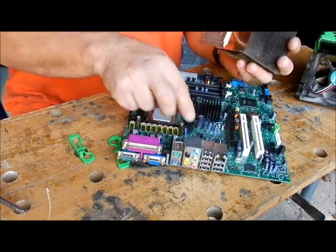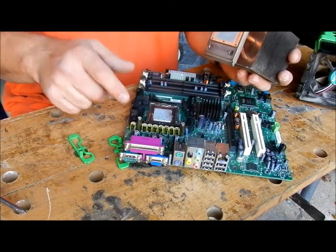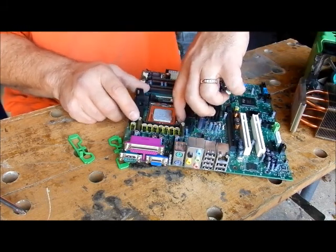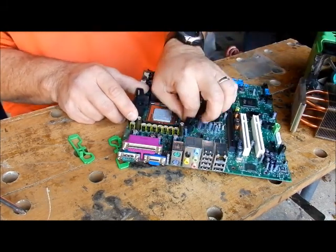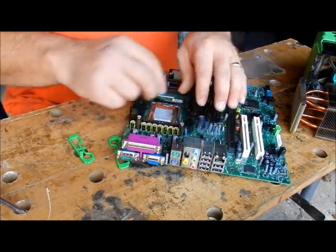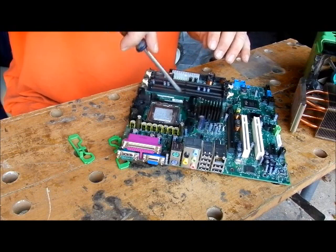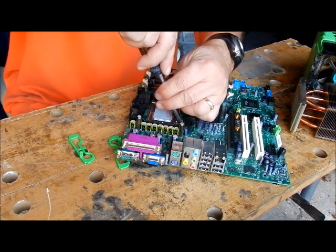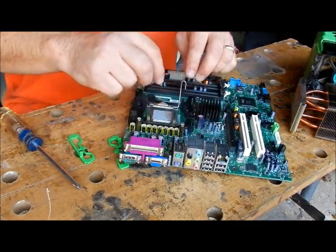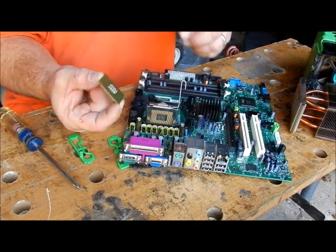You should never have to take out this bracket — the bracket is part of the motherboard. At this time, you should never have to take this bracket out. If you ever had to change out the chip or the processor for some reason — I have never seen one burn up or go bad in 30 years that I've been doing this. With this cage in, it is difficult to get out, so I use a screwdriver. Be careful you don't scrape the motherboard — this is a damaged motherboard so I can do this. Pull this guy out, it slings up — grab it by the edges and pull it right back out. Don't touch the bottom because you'll zap it; a whole bunch of stuff is inside this chip.